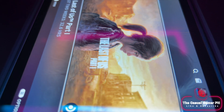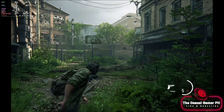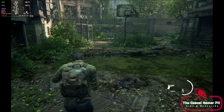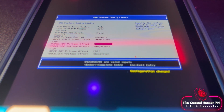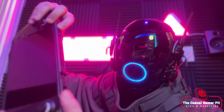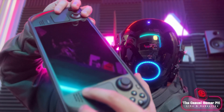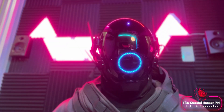What you want to do now is test for stability and performance issues. If we undervolt too far, the CPU will suffer from performance loss and this will lead to crashes. Should everything work fine, you can repeat the previous steps and change the first entry to 15. Remember to do this one at a time — if you undervolt the system too much it might not boot up. In that case, you can try to reset the BIOS by pressing volume down, the Steam button (the button with the three dots), and the power button at the same time. Sometimes it requires a couple of tries.